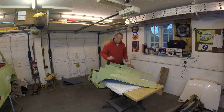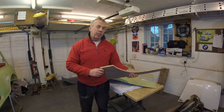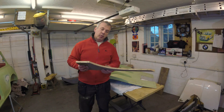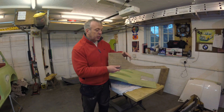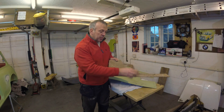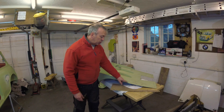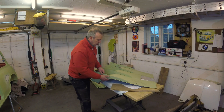The fins — what I've done is made myself a template, just a bit of thick solid ply. Get the curve and shape you want to start off with, then use that to template the aluminium. Cut the aluminium but leave an additional 15mm above the curve so you've got something to hammer down onto the flat surface. Once I cut the aluminium to shape, I clamped it onto the surface, held up the piece of wood, and hammered it over with a panel-beating hammer on the flat. The result is four fins all to the correct shape. Then use some adhesive sealant and pop-rivet them in place, which stiffens the whole thing up.